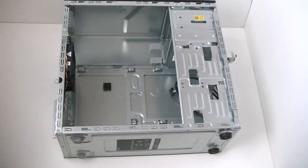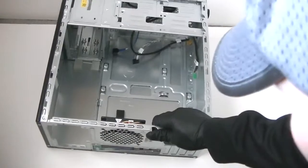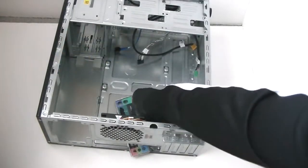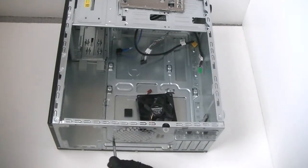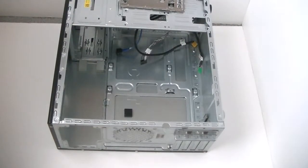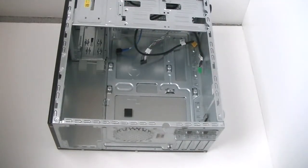The motherboard is now removed. We also have the rear system fan and the IO shield removed. The IO shield is right here in the back — just tap it down and it should come right out. Be really careful with the IO shield as it has really sharp edges — wear latex gloves. We removed the 92mm rear system fan as well. There's also a PCI bracket held by one screw with a secure lock that you can remove if you want. That's about it guys — this is the Dell Vostro 230 mini tower teardown. Thanks for watching, bye.